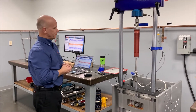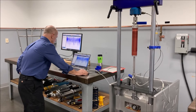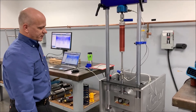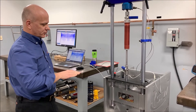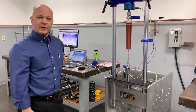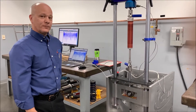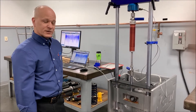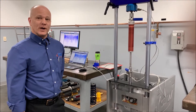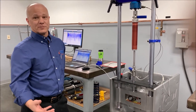So I'm just going to come back and run the same test, except now it's going to have the shaft. We do that two-second warmup, and then just do that gas test. By doing this pause, we're getting the load cell to stabilize. After that, it's going to move, and that movement is what I'm hoping this customer is going to get some data from — how much of a force spike is he getting? Some of it may be from the dyno itself starting to move, but from what I've seen, we're able to measure a very small percentage of load cell change.